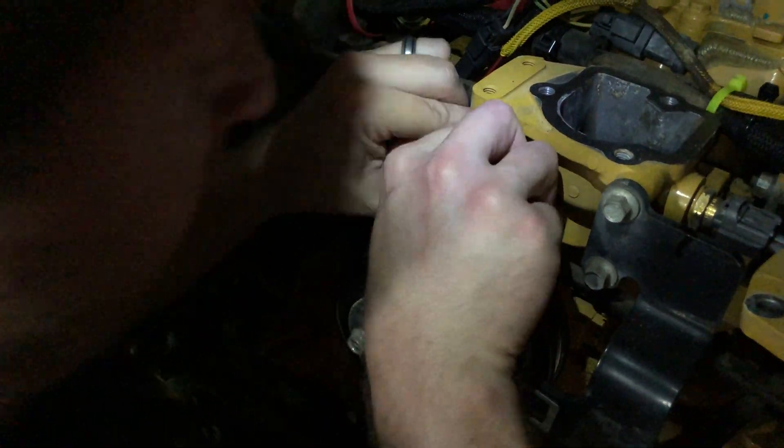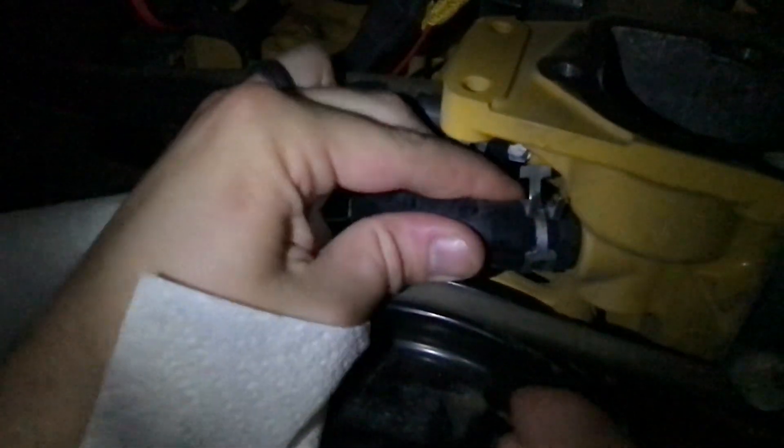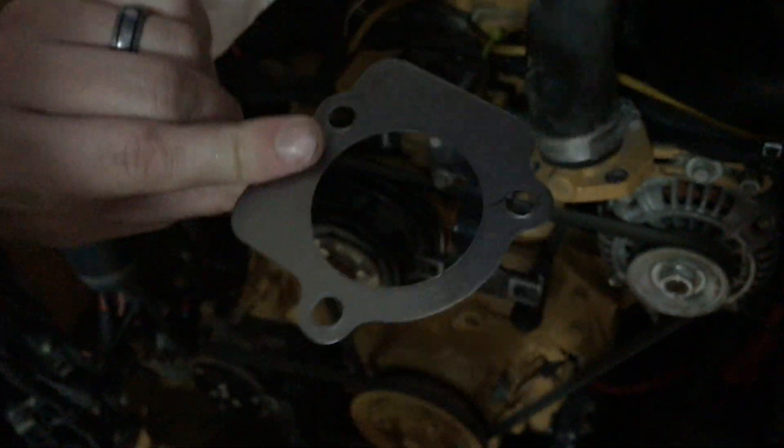Colleen's tip — smart! You want to make sure you've got some clearance here. When we first put it on it was rubbing directly against something, so we're rotating the tube around and trying not to kink it so there's clearance between the pulley and the tube. Also make sure you get the hose past the little barb on the tube fitting. Here's the new one — I'm glad I bought two because the other one I didn't like as much.